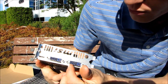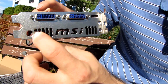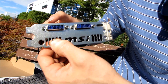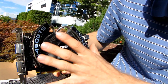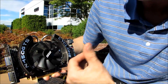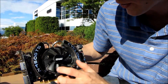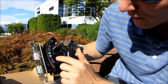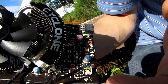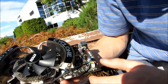On the back we've got two DVI ports as well as a mini HDMI, with the typical MSI branding built into the PCI backplate. It's not critical that they have all this ventilation here because this is primarily an interior exhaust design, meaning you're not exhausting a ton of heat outside the case. The benefit is that you keep the GPU cooler and get incidental airflow going down over your RAM and power circuitry, while still exhausting a little bit of heat outside through the vents.